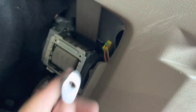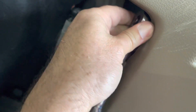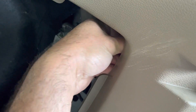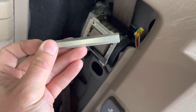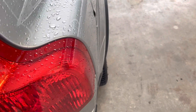Pull it out and set it down. The top one is hard to reach with just the ratchet tool, so use a ratchet with a 10mm socket and a short extension, reach it in there, and stick it on the head of the fastener. Loosen it a little bit, and then the rest comes out using just your fingers. There's a sharp edge of plastic right here so be careful not to hurt yourself. Pull it out, get both fasteners out, and then carefully pull on the light — put the camera down and use both hands.